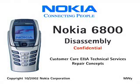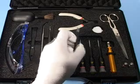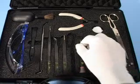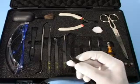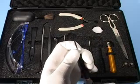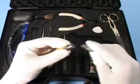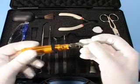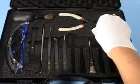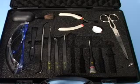Nokia 6800 disassembly. You will need the following tools: metal tweezers, a straight-bladed screwdriver, Torx 6 driver for removing screws, torque driver for tightening screws, and the SRT6 opening tool.